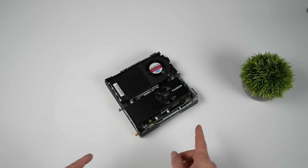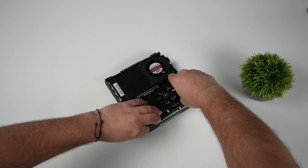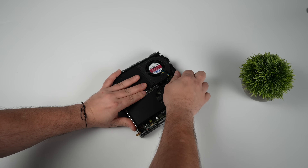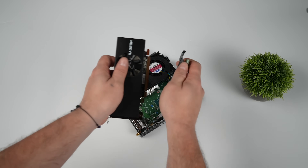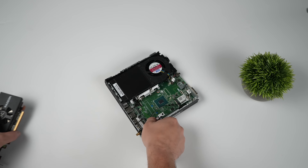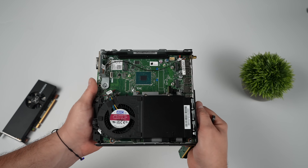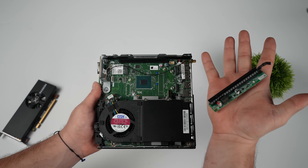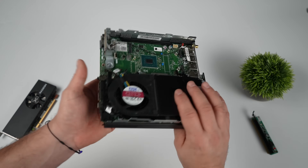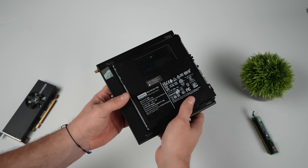So for this I opted to use a low profile single slot RX 6400. The main thing that's going to hold this card back is the fact that it only has four gigs of VRAM — I really do wish they would have released a version with six gigs. The way you get this in here is with a proprietary PCIe adapter for these Lenovo PCs. From Gen 1, Gen 2, and Gen 3 they're all different, but with the Gen 3 variants this slot can actually run at X8 4.0, so we can get full speed out of this RX 6400.